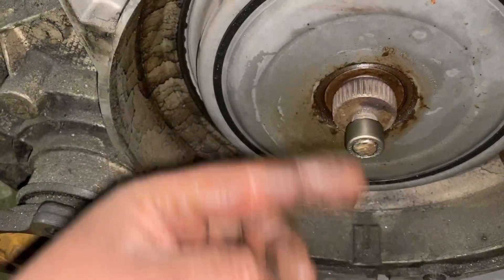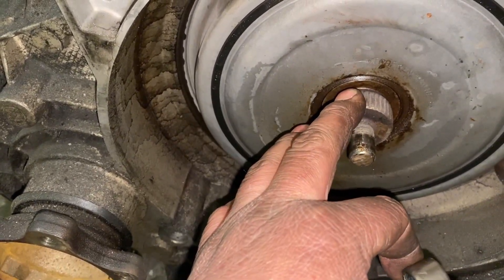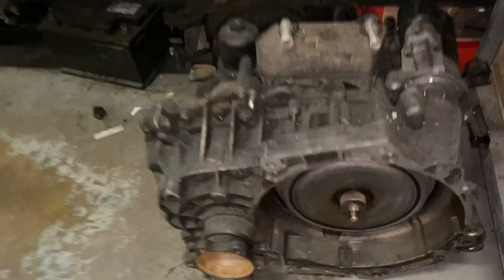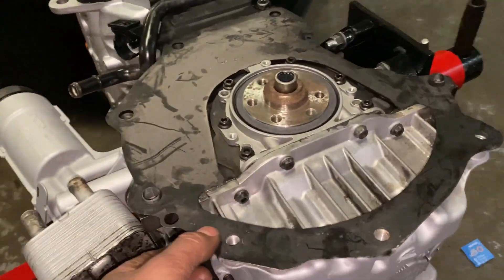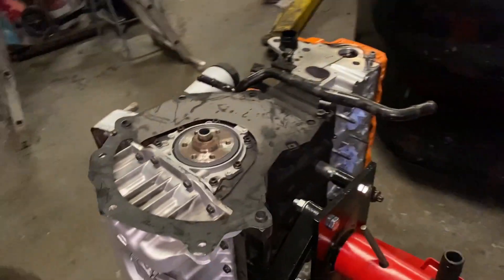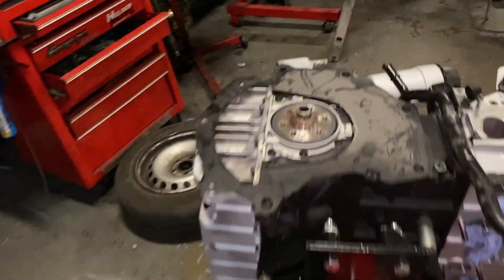This output shaft can't have any play because it holds the clutch pack and the primary gears inside the gearbox. When you're doing this application you have to buy a spigot bearing and press it onto the crank, and you have to use a plate like normal.